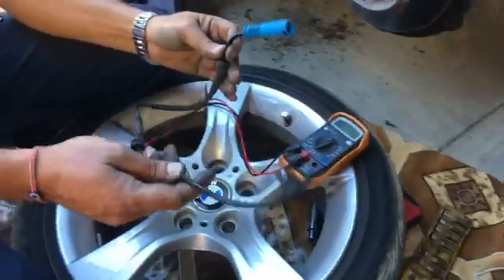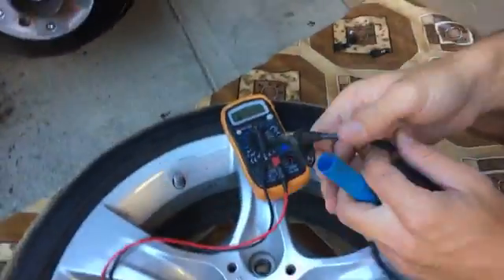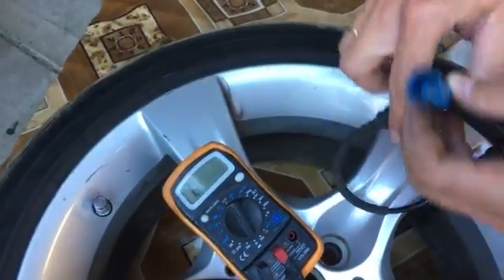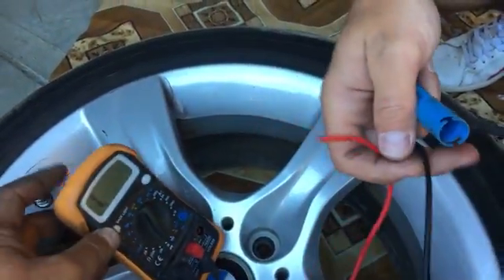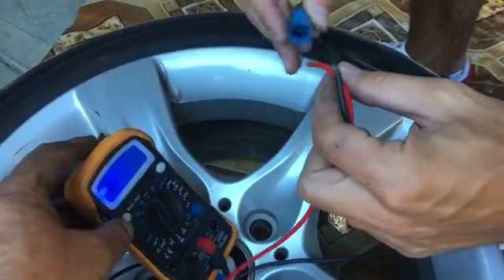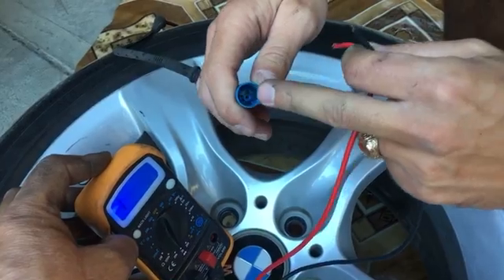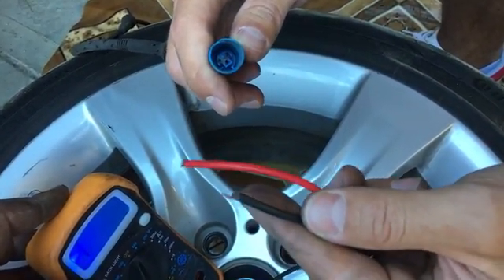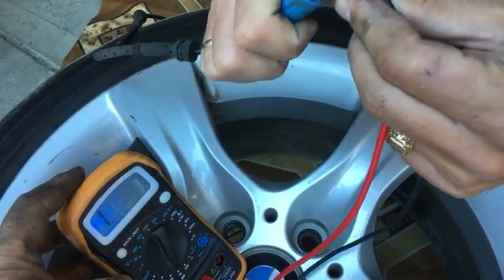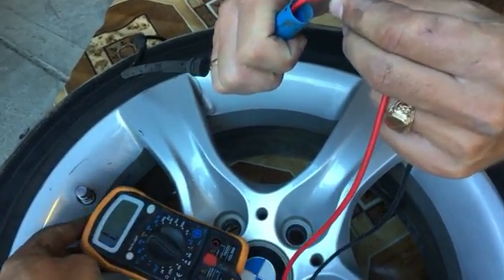This is the ABS sensor we have right here. Inside you have two wires. We're going to set the voltmeter to 2k. For that specific BMW it should be about 0.7 — plus or minus some tolerance, but about 0.7. You need to connect each of the leads inside with the voltmeter wires. It's very deep so it's hard to see and touch them to get them in place, but just bear with us.